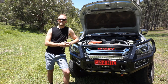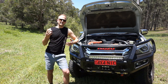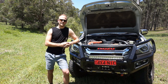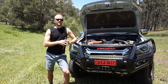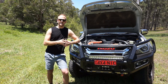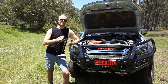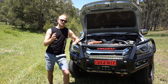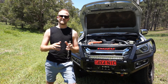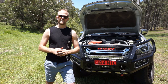Issues with oil going through the intake don't usually show up immediately — it takes over 100,000 to 120,000 k's until it really starts building up and causing problems. I think that's the main reason manufacturers don't fit catch cans from factory: the vehicles are usually out of warranty by the time issues arise. I'm really happy with how the Provent 200 is going — mega easy to check, super easy to drain, and working extremely well. I just need to remember to change the filter in around 30,000 k's. Thanks for watching — please give it a thumbs up, subscribe, and stay tuned for more four-wheel driving accessory and maintenance videos!